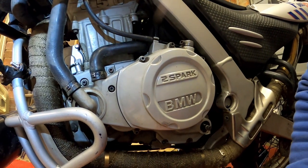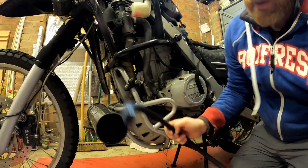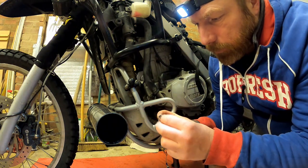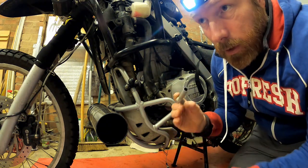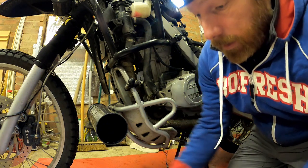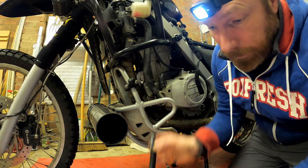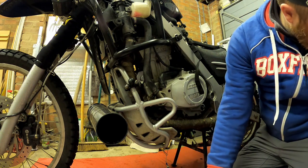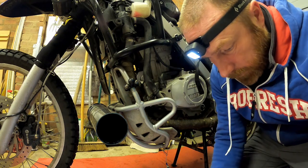The proper manufactured braided hose solution costs around a hundred pounds; this flexible hose fix came in at maybe twenty pounds all in. I filed the cut ends nice and smooth, which created some metal shavings. I then washed it out with engine oil, let it drain through in the direction of flow to carry the filings out, and hopefully that's removed any nasty contaminants from both the pipe sections.